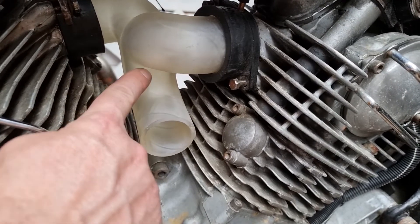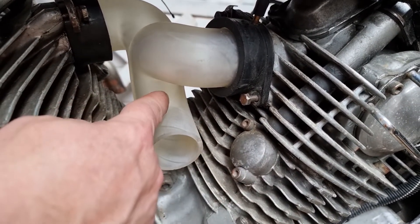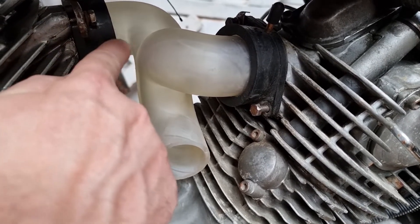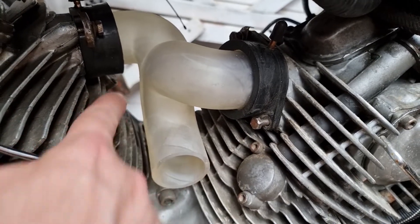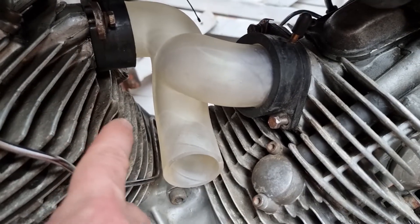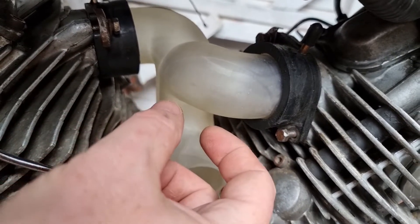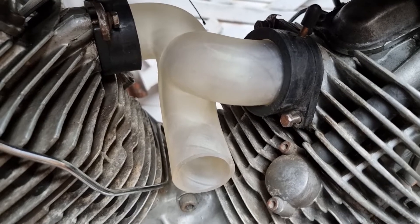I've put a slightly longer neck on this one so the fuel's got a bit longer to mix. I figured the longer the neck from the curve to where it splits, the less bias there'll be — because obviously it's flowing that way so it's biased to this cylinder. The more upward force it comes up with, the less bias there is, and he said the other one ran pretty well, so I'm hoping this just adds to it.